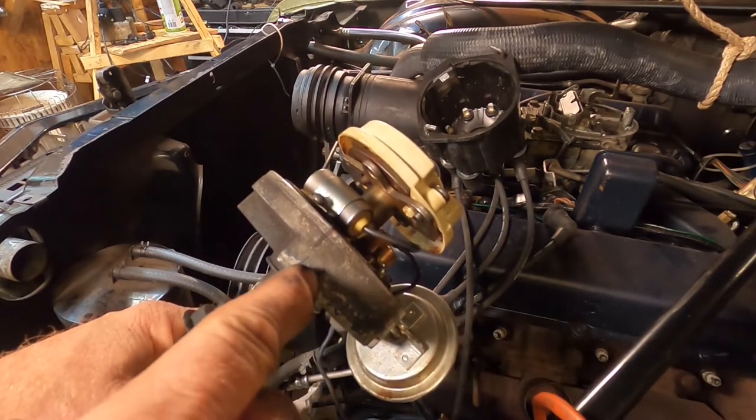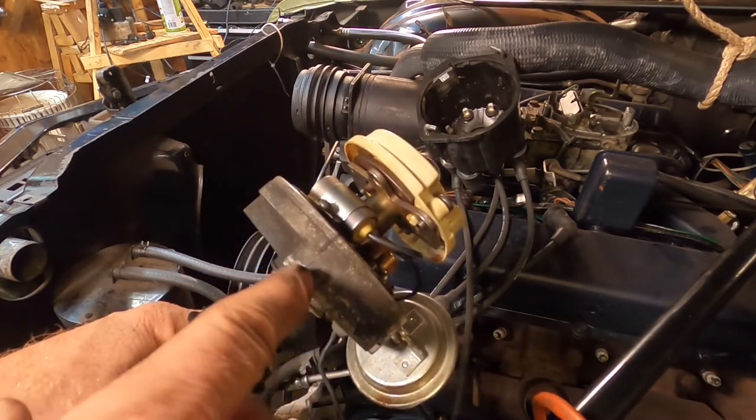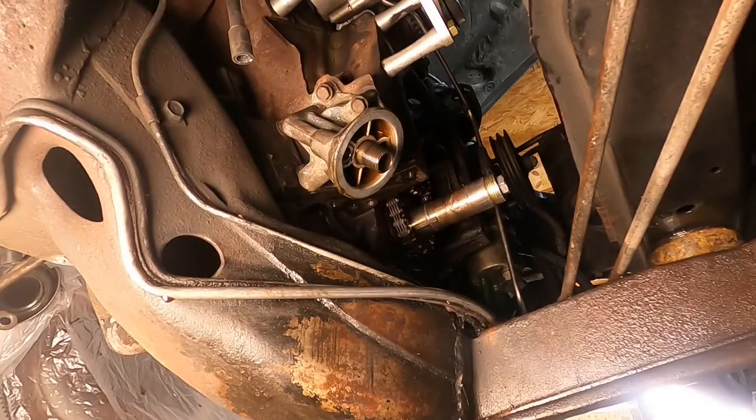Well, guess what that is? That's the advance that's built into the distributor, right? So we've got a few degrees of advance. I forget what it is, 8 or 10 or something like that. All right, we're following the manual here, folks. We're not just lollygagging around here. Actually, I'm following the procedure for the camshaft removal. Comically, there is no procedure for timing set replacement.